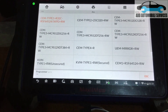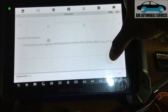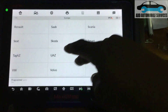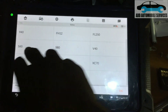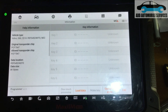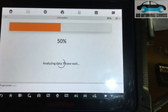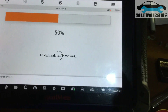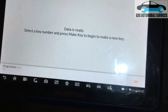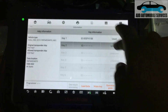I'll do the other unit also. After getting the key I can read the key and write it to the system. I'm trying to write the key or check the number of keys in it. There's the S60 and that's the R5. I have to load the key data — the EEPROM — to know the number of keys in the system. Now you can see only one key is in the system.